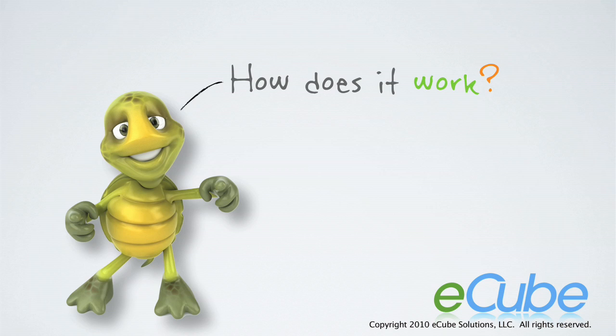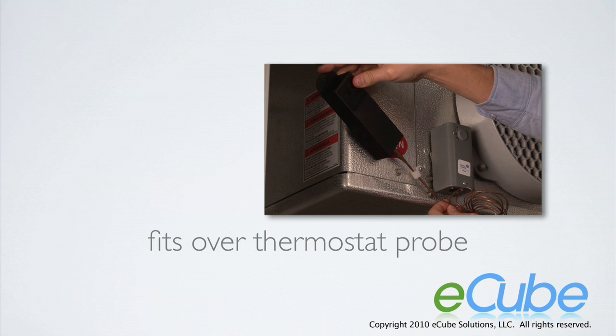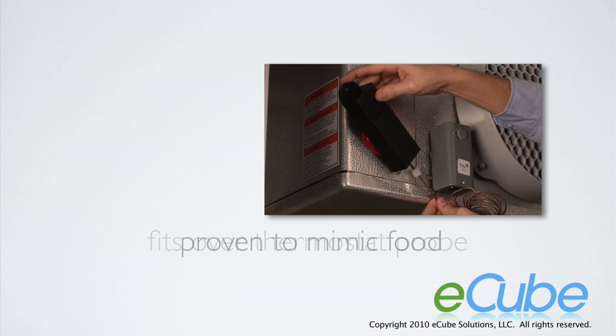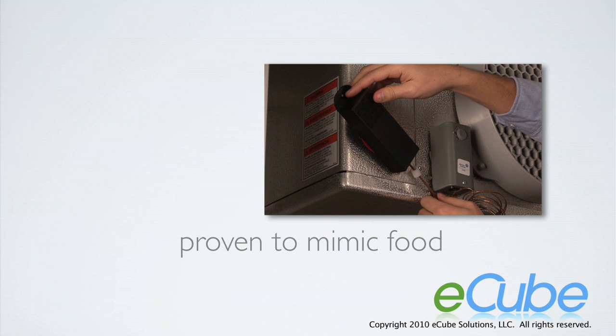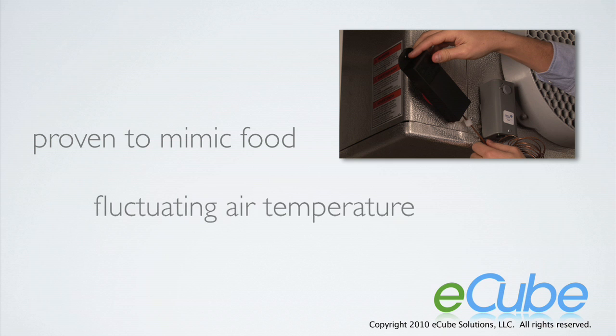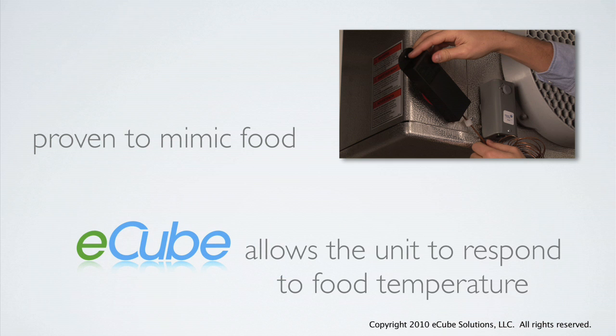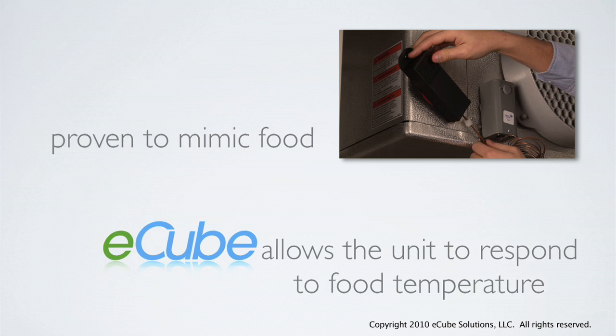It's a simple device that fits right over the thermostat probe on a refrigerator or freezer. Inside eCube is a material that has been proven to mimic the properties of food. Now, rather than responding to rapidly fluctuating air temperature, eCube allows the unit to respond to food temperature instead.